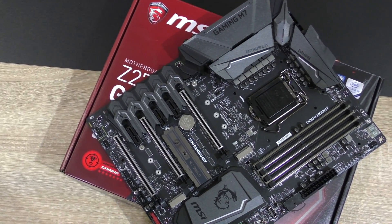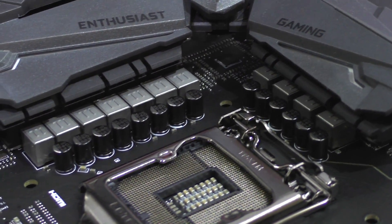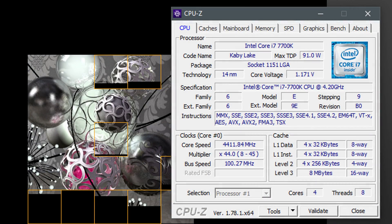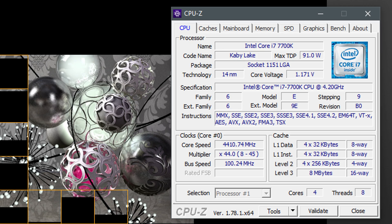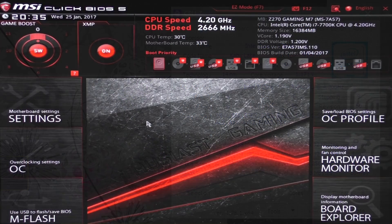Or maybe your chip will even exceed mine. But with this high quality Z270 motherboard by MSI with a 12-phase VRM power design, I theoretically should be able to overclock fairly well. For reference, with this motherboard my 7700K at stock clocks runs at 1.171 volts at 100% load.